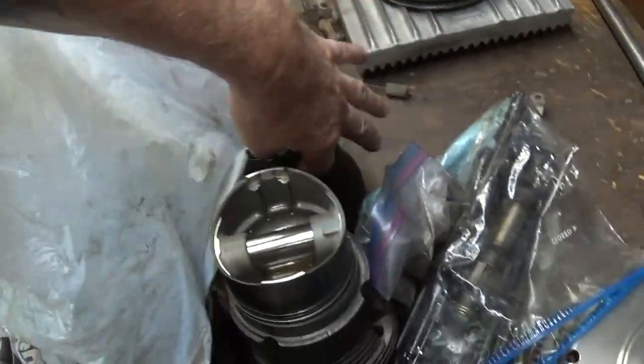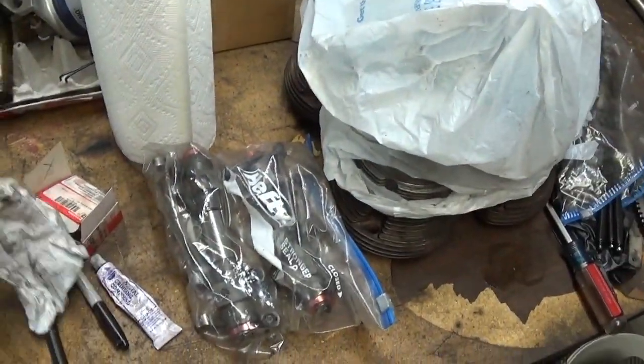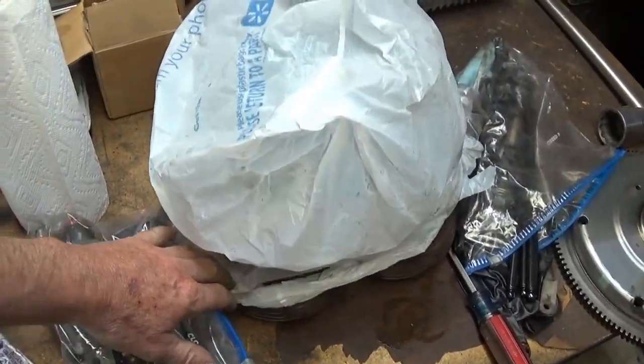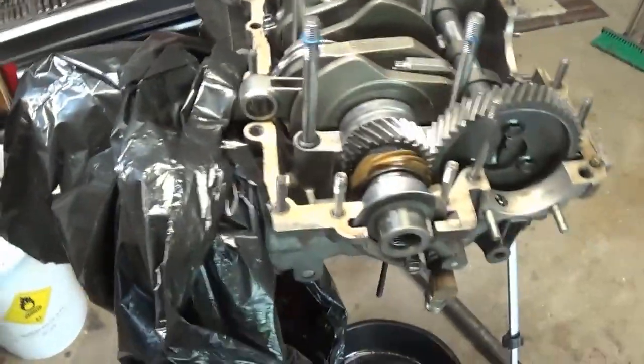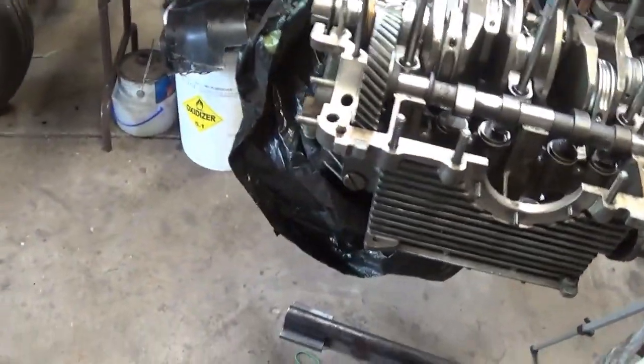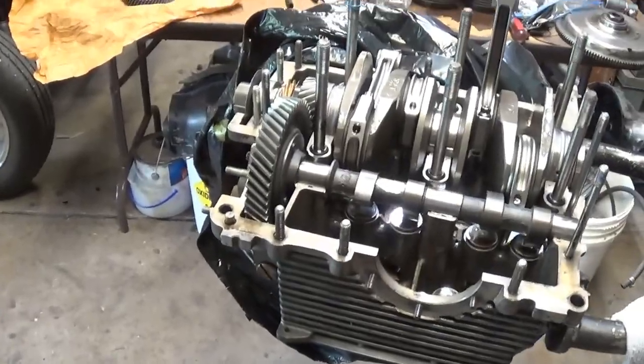I'm done with these newer stock style pumps. They vapor lock easy. I'm not happy with them, and it cleans up my engine compartment. I had a fuel injected case that didn't have a pump location on it, so I ended up putting electric pumps on all my cars, and I'm very pleased with it.